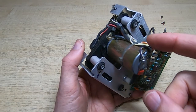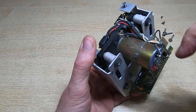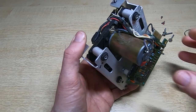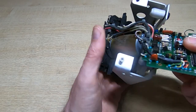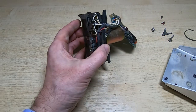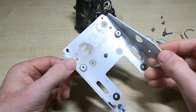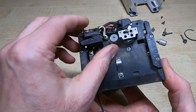That's now loose — just takes a bit of persuasion. You will need to cut this cable tie because we will be taking this motor out and we don't want to have to disconnect all the wires. What you have to do is try and squeeze all the wires through, turn the board sideways, and then this should lift out. It's a bit of a wriggle, but we've got that out. Now we need to get the motor out, so we need to get the drive capstan out.